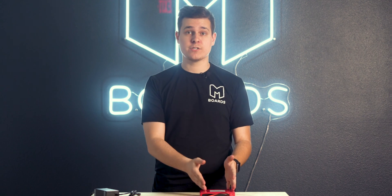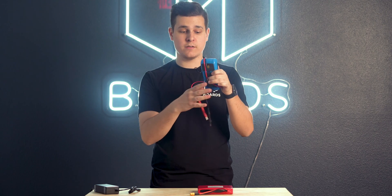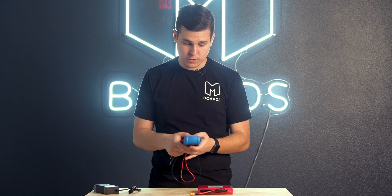Once you verify that your VESC settings are correct or that your ESC and battery do match, we'll move on to testing your battery's health. First, make sure you fully charge your battery — our batteries are not shipped fully charged, we actually ship them at a relatively low voltage. To rule out that your battery is simply dead, plug it in for a few hours until your charger reads a green light. To test the battery, we are going to use a multimeter. If you're serious about this hobby, I really recommend getting one — I left a link in the description for a cheap one.